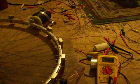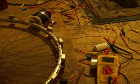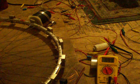Oh, I forgot to hook up one of the wires. This wire will dead-short the coil constantly if I leave it hooked up when the relay is off, but when it's connected I have to have this one on too. Now there's no battery voltage coming into the circuit besides going into the relay switch that just shorts out the coil.